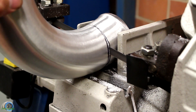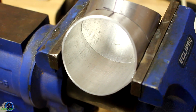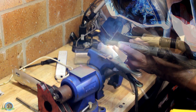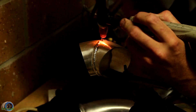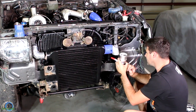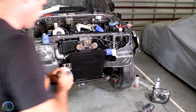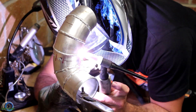I'm cutting the ends off this long radius 90 degree bend at a 17 to 18 degree angle — this will be the start of my tight radius bend. I then cut two sections and prep them ready to be welded. You want the two pieces to fit well together, as this will stop a heap of heartache when you're ready to weld. Before I lay down a bead, I like to do two small welds on opposite sides of the pipework to stop any movement from heat, then get into a comfortable position and start laying some welds.